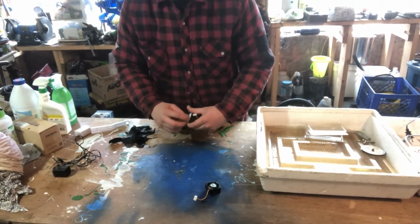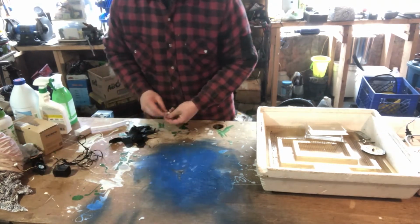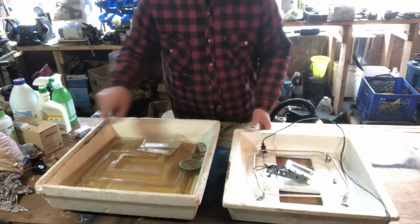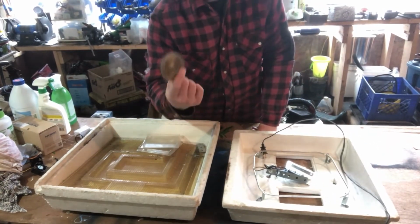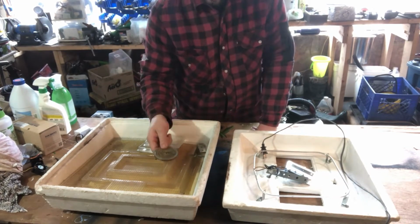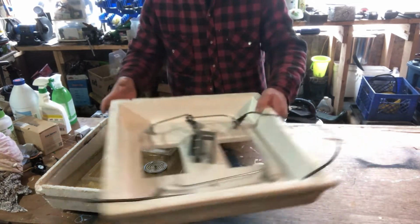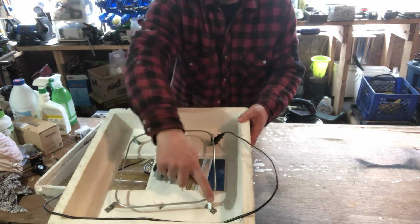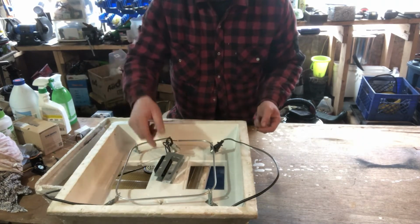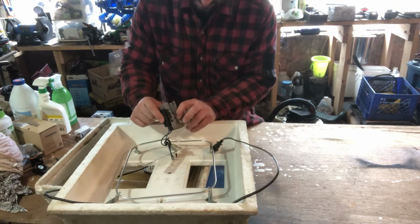And then the third thing, I'm going to do something different as well on the temperature controller. So this, I was taking this apart the other night. I was describing this thing called the wafer, and how this is what controls the temperature. And what's inside here is just a regular 120 volt heating element, something similar to what's in your oven, but smaller scale and less power. And it works off of this here.